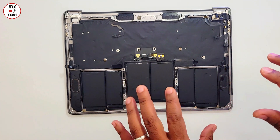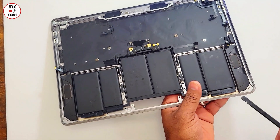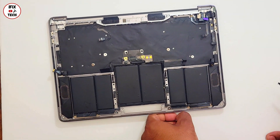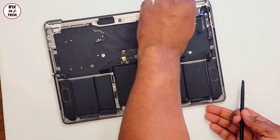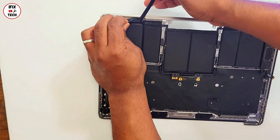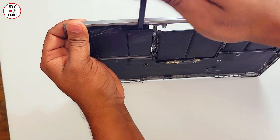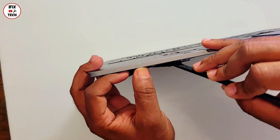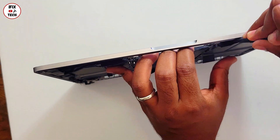Wait about two minutes, put it aside, and then you're going to try to remove the battery. Now using your plastic tool — make sure to use a strong one — you are going to try to pry open the battery. Put the tool under it and just wiggle it to try to cut the adhesive. Heads up: even though we used alcohol, this adhesive is really strong, so during the process you're probably going to have to apply more alcohol to help make the job easier.